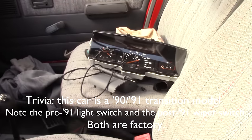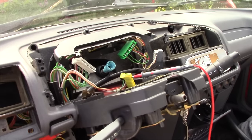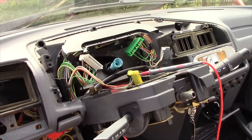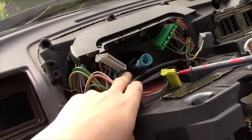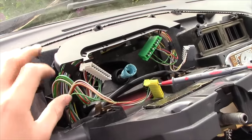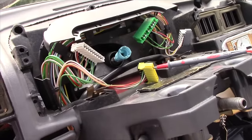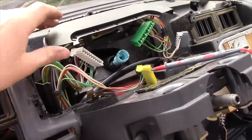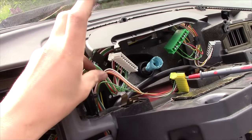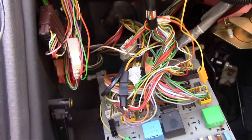I reverse engineered the dashboard a bit and found out that the parking brake light can be turned on from two different wires — one of them being the last pin on that one, and the other being the second pin on that one. So I figured maybe this one was shorting to ground, and maybe there's a wiring loom problem, because there are some rather sharp turns on these cables, and the French cable routing isn't really the most tidy job.